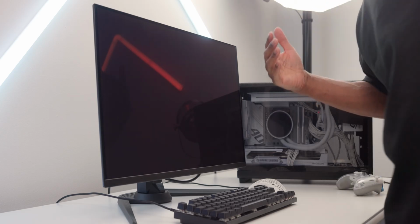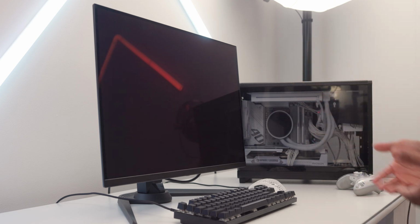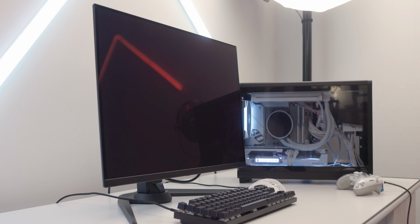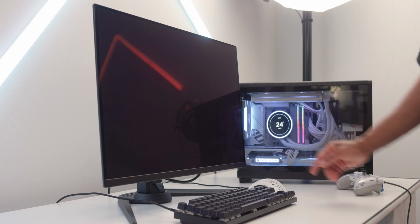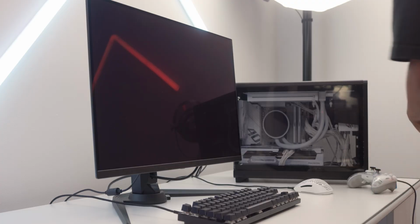YouTube, it's time to finally boot up this system. It should just get straight to running. It is a previously assembled system with a few changes, just new fans and whatnot. So let's see if we actually have everything wired correctly. Uh-oh, I think the blinking means there's not enough power for that from the motherboard for these 3 fans, which means I need to use that connector, which will allow for SATA power to go to this. You know, PC building has its challenges.